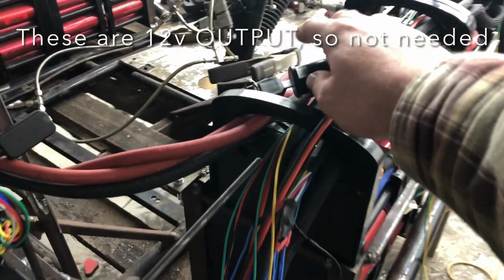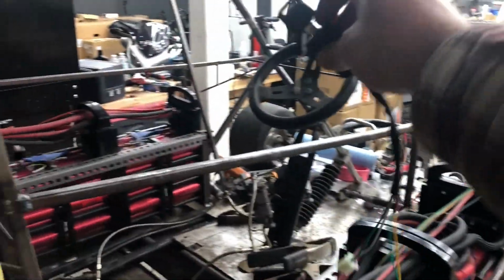So if I throw this switch, which I also wired in, this is running up here and back down. This is supposed to go on the left side over here, so it's got extra wire there. When I throw this switch, it turns on that relay, which then sends power to 12 volt, which then opens the contactor, so I get 96 volts main through to the controllers. And I also get my 12 volt to turn on, which turns on 12 volt in the back, turns on the 12 volt line I have in the front for some of my accessories up there. And I have my Bluetooth modules connect to the controllers.